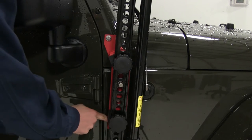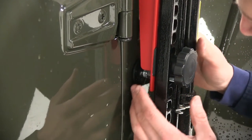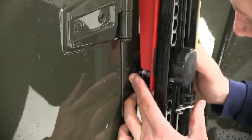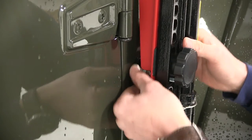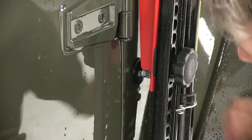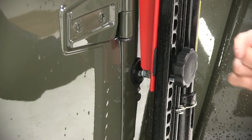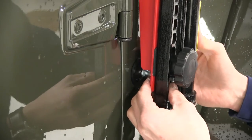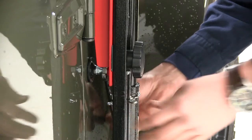Now we can adjust our lower bumper. The idea is to make sure that the bumper makes contact with the Jeep. We don't want to tighten this down — it's just like an anti-rattle device, just to keep the rattling from happening. Once we get it somewhat snug, we can take the lock nut and bring it towards the jack, and that's going to keep it from backing off. That just requires a 9/16ths wrench just to get it snug.